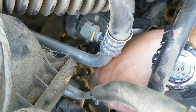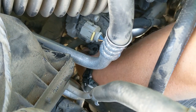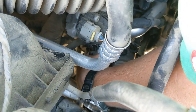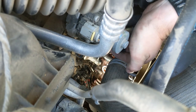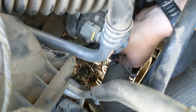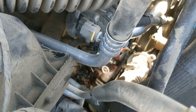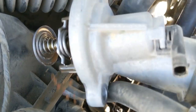Now everything works out — I should be able to pull this off, drain the fluid, and disconnect the electrical connector. You can see that plug there — push it down right where my thumb is and then pull straight out. Crawl around on top of the truck engine — there we go, got it out.